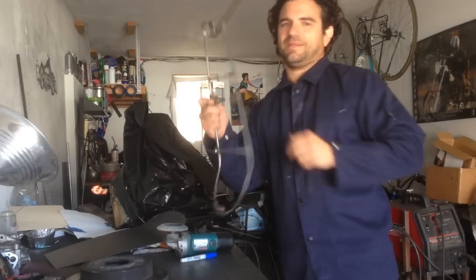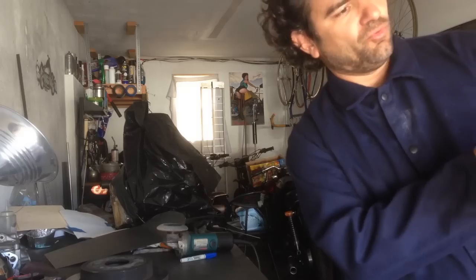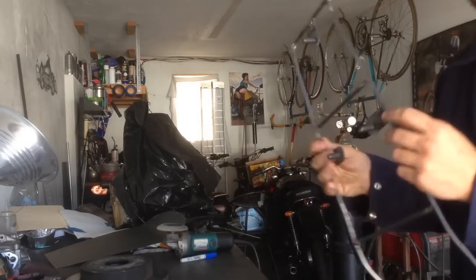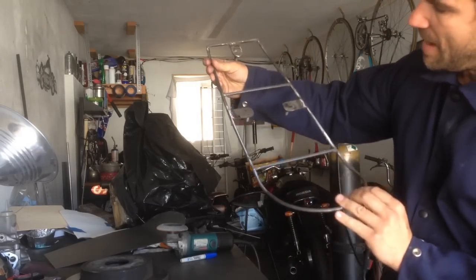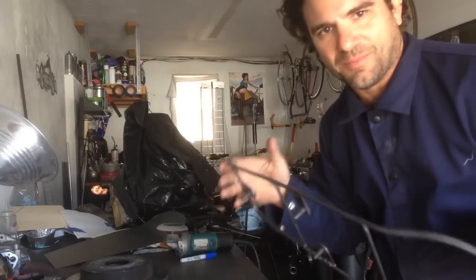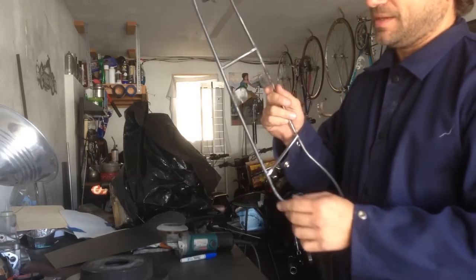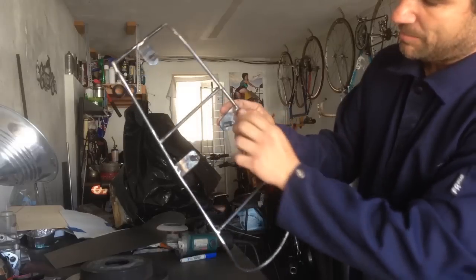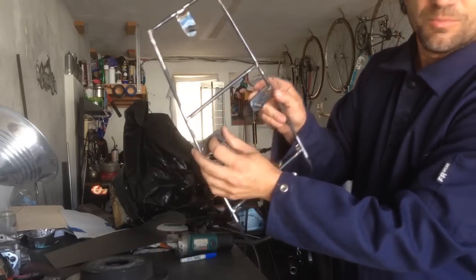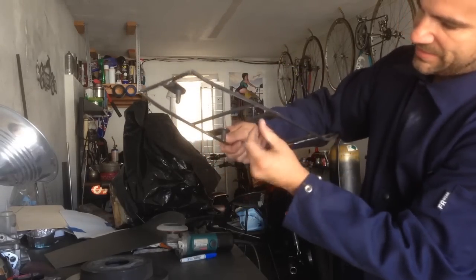Hey guys, another small update from Prospect Shop on the VVMC raffle rally bike. Finished mocking up or framing the seat. This was definitely inspired by my buddy Dustin Cott, who is an amazing cafe racer motorcycle builder. I integrated the bolts into the brackets and welded them in here, so when we place it on the frame, we can just fasten this with wing nuts.